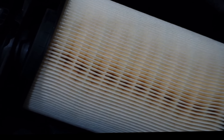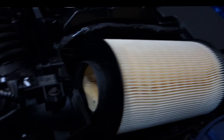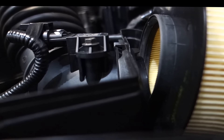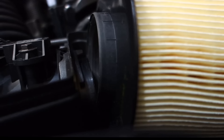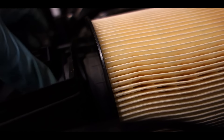You need to use these two tabs here to hold your filter in place, and then squeeze the filter in to put the rubber neck into the tube itself. You cannot put the tube on first and then slot the filter in — I tried that and it's almost impossible. So you need to do this part first, and then squeeze the air filter into the tube. You need both hands to do that. Put the filter against both tabs and put the slot into the slot.